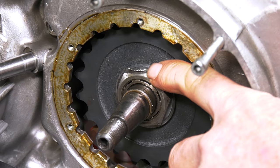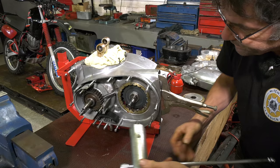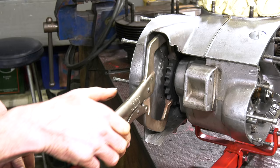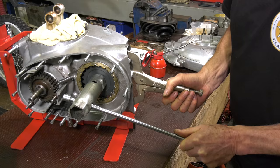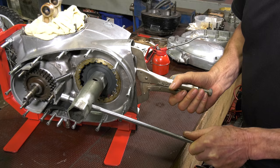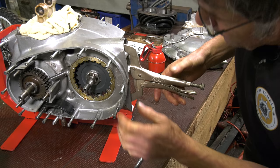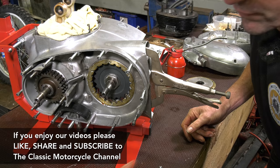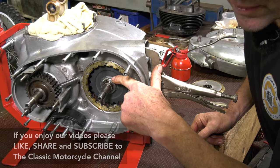You'll see that we've got the nut there with the tab washer already bent over. To show you how easy it is — with a box spanner literally on the nut, you can get good leverage. Hold this because you're on the bottom part of the casing here, but then you can get really good pressure. Use a long tommy bar in your box spanner and pull that up really tight. Then you only need to use one of the flats to bend over your tab washer. Rather than what people tend to do — knock it around with a cold chisel — but you can't get it tight that way, and also you'll muller that nut.